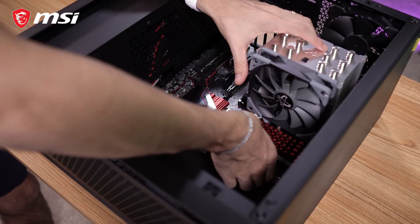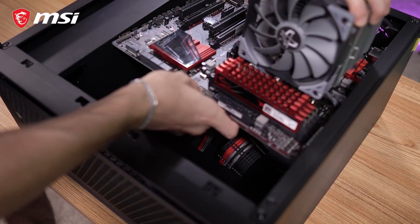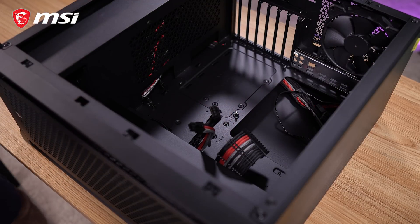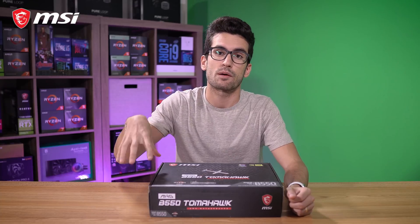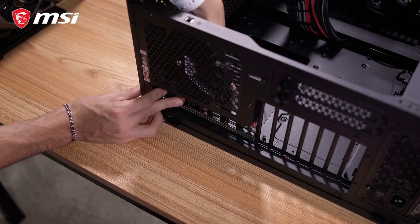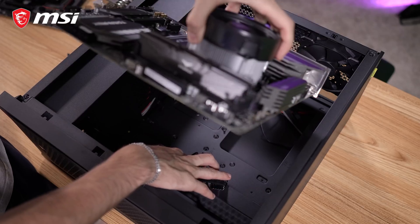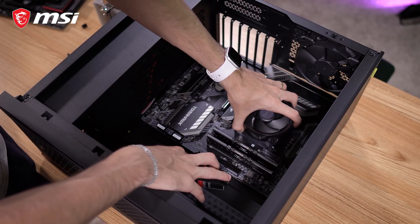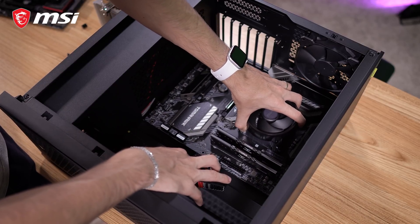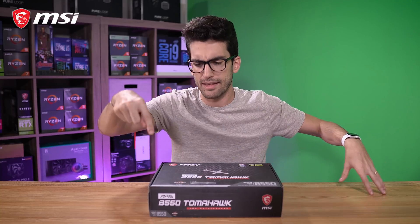Now it's time to change some parts. Remove your graphics card, disconnect all cables leading to your motherboard especially, remove standoff screws, and carefully lift the motherboard out of the system. You should be able to lift from the edges if possible, but if you have a large heat sink, you can grab it from there to help. Swap out rear I/O shields and CPU air coolers if necessary, and repeat these steps in reverse to situate the new platform in the case. With the inside job finished, connect the USB boot device you created earlier, and a keyboard and mouse. Now it's time to fire up the new build and spam that delete key.